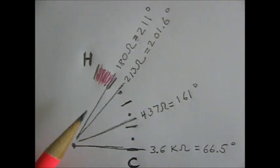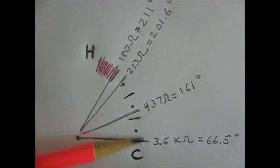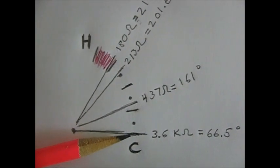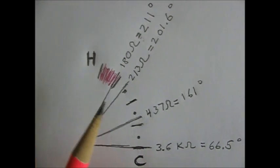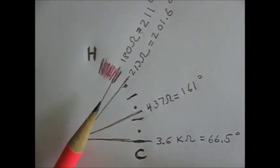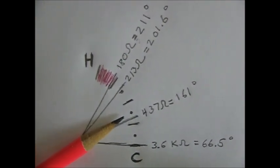Here's a representation of the gauge. I took four readings in the course of troubleshooting this and came to trust the sensor because it was consistent — especially at the low end. At 66 degrees on a morning when it was that temperature, it confirmed the sensor is good. The gauge, however, is overreacting. At 211 degrees when the fans came on, the needle should be down below the midpoint. It's an instrumentation problem.